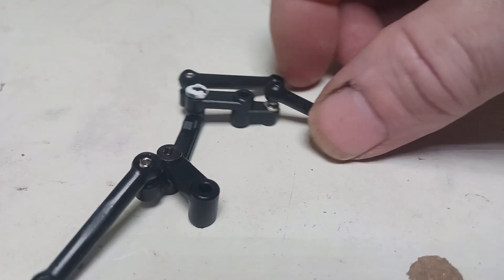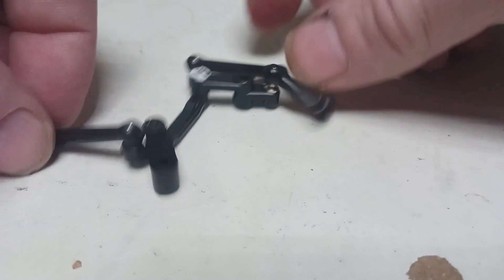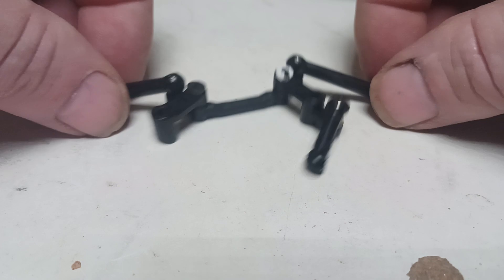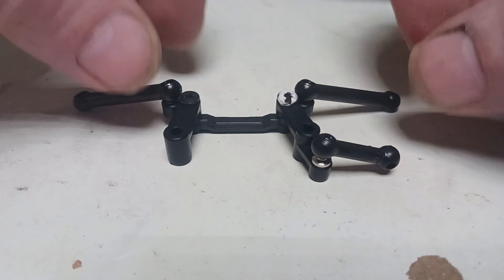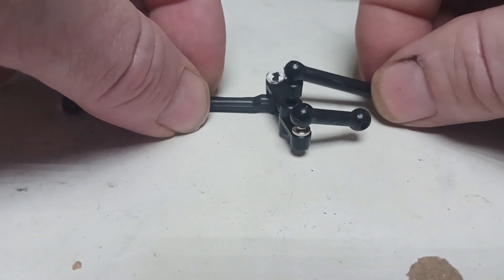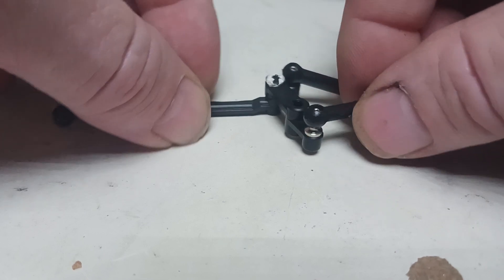And there's a simple fix. As you can see right here, what's happening is this steering mechanism — this would go out to the right front tire, this would go out to the left front tire for steering. This is called a bell crank system; this end right here would hook up to the steering servo. So what's happening is if I hold one end still and I move the tire in and out, I get a lot of excessive movement in this guy right here.